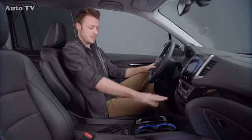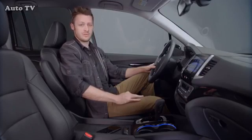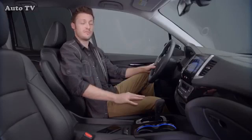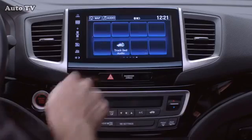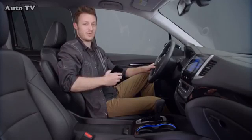To get started using it, make sure the transmission is in park and the ignition is either on or in accessory mode. You can play music from almost any audio source, but if you want to stream it, make sure the phone is paired and the music source selected is Bluetooth. Then touch the truck bed audio icon on the display audio home screen to turn it on.